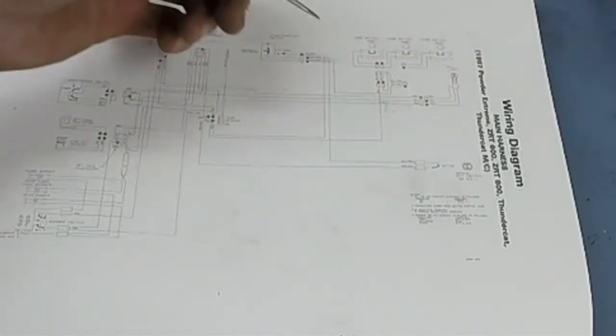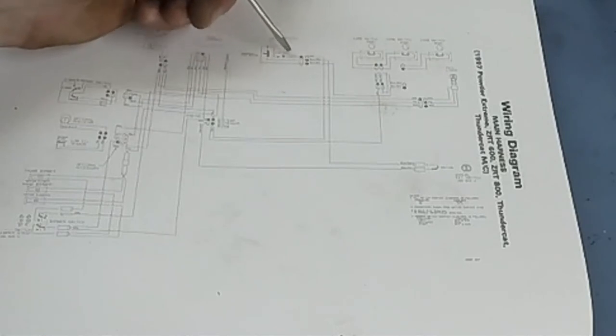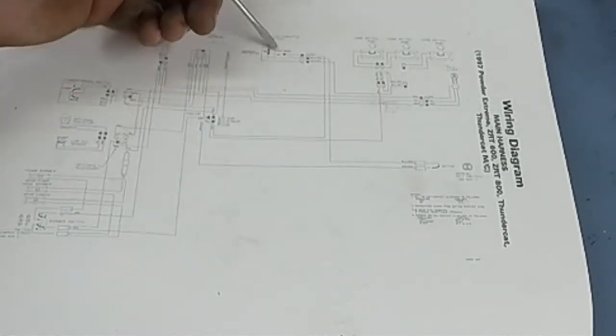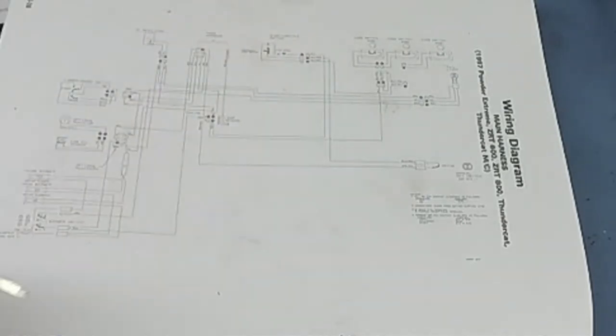So then that part of the circuit is always closed. As long as you have the emergency stop in place we shouldn't have any issues. I'm going to test it here in a second to make sure by holding open the high-speed switch and making sure that doesn't mess anything up. But since there's no connection there anymore it really shouldn't, because with the emergency stop closed in a run position, you should still have a complete circuit.